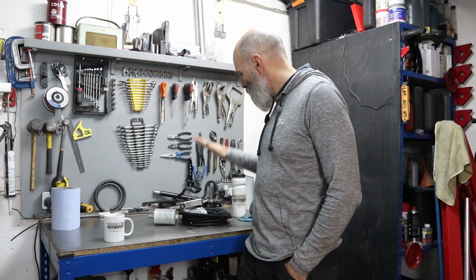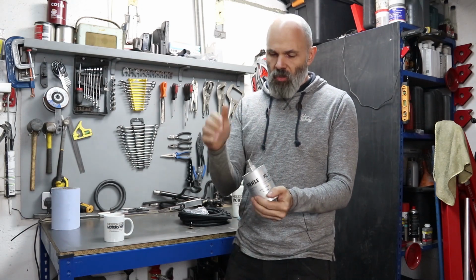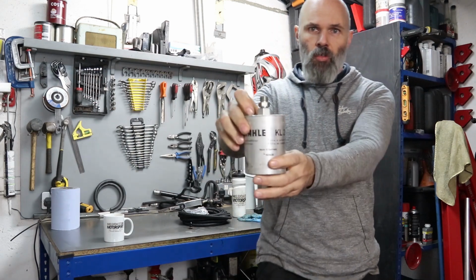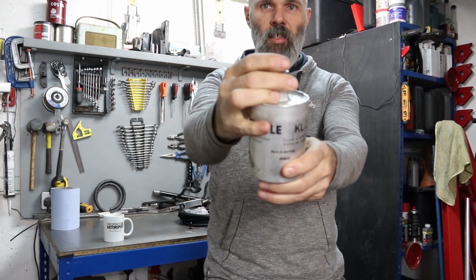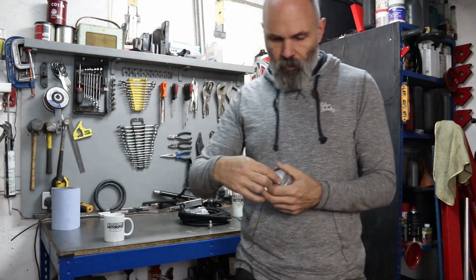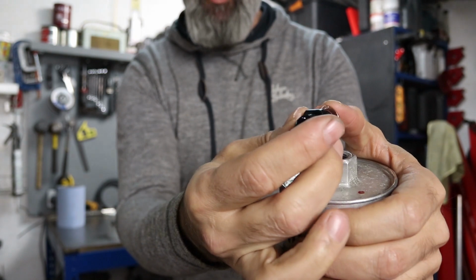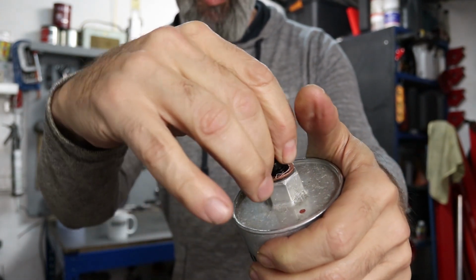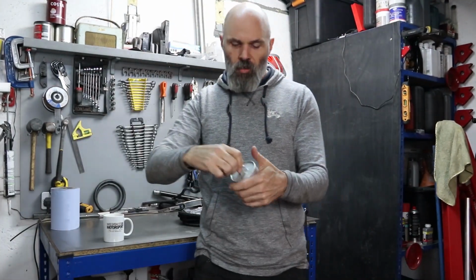And I'm back. Although this being a video, you won't actually see any difference, but I've ordered in some additional bits. So an extra load of fuel line and an adapter for the fuel filter to take me to an AN6 fitting. Essentially, on the top there, if I remove this one, which is designed and fits the other ones, I don't know what connector that is, to be honest, for me to be able to get an adapter for that. And essentially what I've got now is this little metric thing here to go on in place of the factory one, and that with the new washer on there will just screw in. So yeah, I'll get that on.